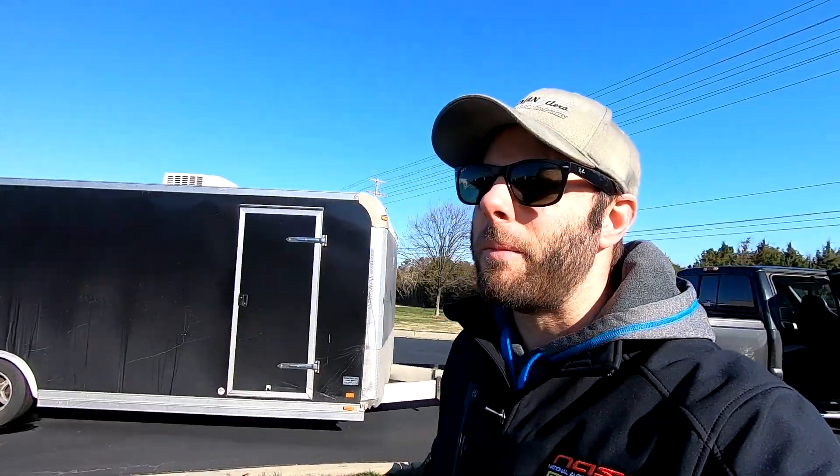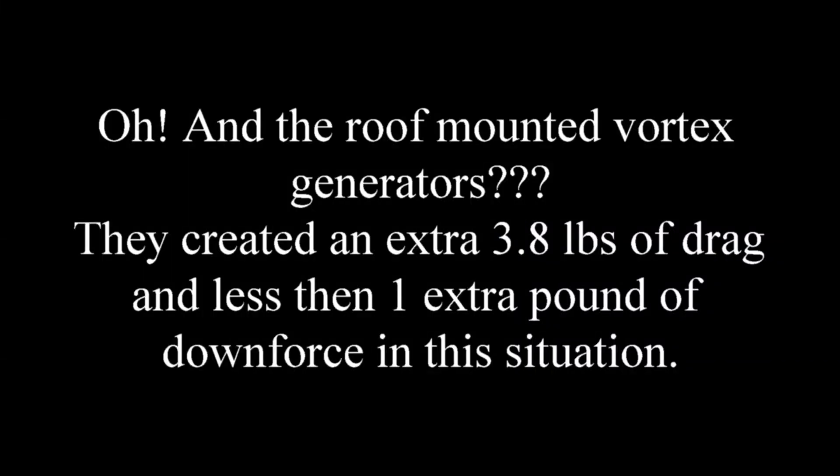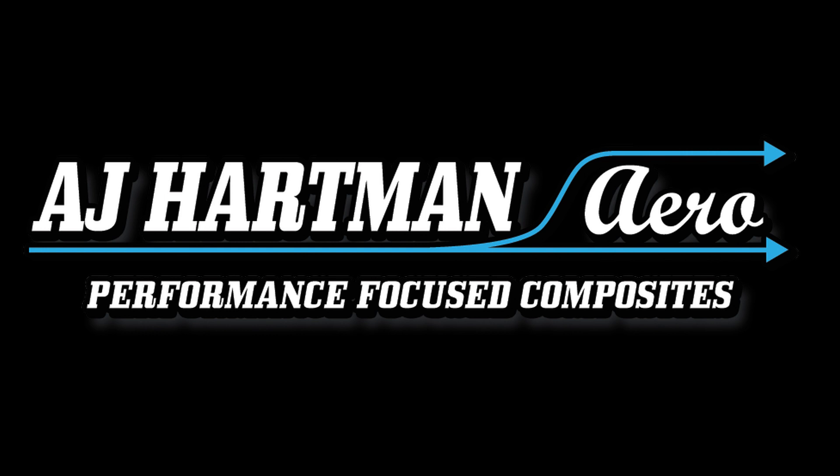We finished the last run with our Fulcrum 14 at five degrees, technically four. Most downforce, most drag by a little bit, so the car's lift-to-drag was the best by a long shot. I think that's about a wrap — we're going to get the car out of the tunnel. That's it for this one, we're done today at the A2 wind tunnel. It was my third time here, the longest single run. We learned a ton, we kind of have more questions than answers but got a bunch of good data. It was cool comparing our wings to some competitor wings, and Al over at Race Louvers doing all his hood louver stuff. If you like this video, give it a thumbs up, hit subscribe, and I'll see you in the next one.